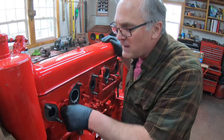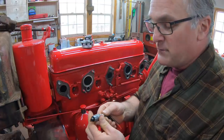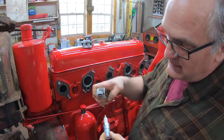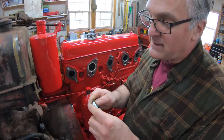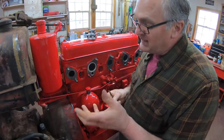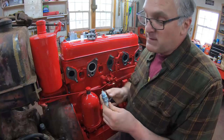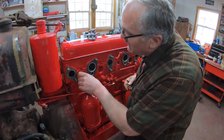While I've got everything stripped down here, I might as well take out the old plugs and put in a new set. The old plugs were Champion D89Ds — a long reach plug with an electrode that comes off the side instead of on top. The new plugs I got are also Champion D89Ds, same configuration. The gap on these is 025. I checked with the supplier I bought the electronic ignition from — with electronic ignition you need a high voltage coil and the right core wires, graphite core. He said this plug is what they run with electronic ignition, same as original.